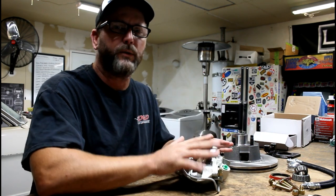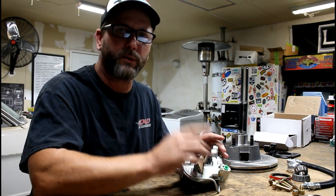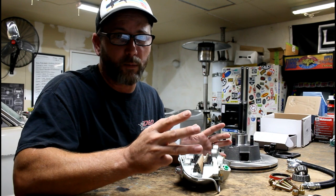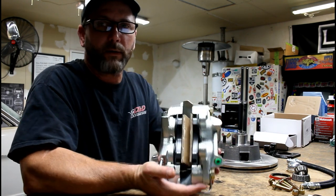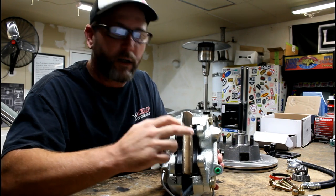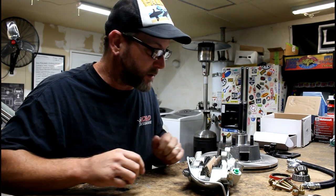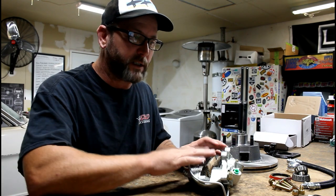What really makes this kit unique is that rather than being your standard disc brake caliper with a single piston, this kit has not one, not two, not three — which would be kind of weird — but four pistons. This is a four-pot caliper, with two pistons on each side. These are very high performance calipers set up for a lightweight car like our 66 Mustang, so we ought to be able to stop on a dime.